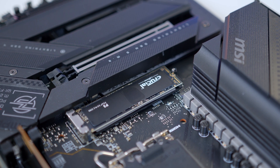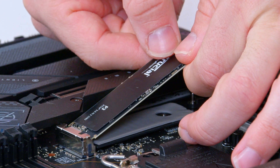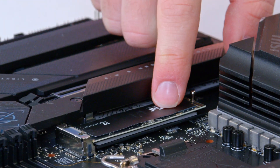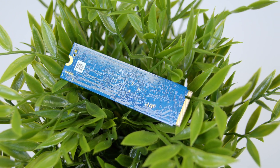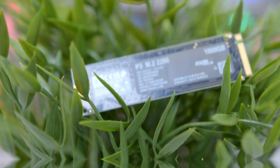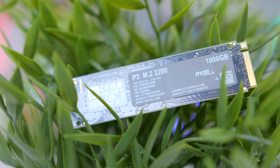The newest standard of drives are what we call M.2 SSDs — a drive like this that fits into a smaller M.2 form factor. It requires no cables and is easy to install, as I'll show you how in just a moment. Originally when M.2 drives launched, some brands would take their older SATA drives and package them in an M.2 form factor, limiting the speeds to their old SATA standards. Whereas this is a fully fledged Gen 3 NVMe. Since then you can also now find Gen 4 drives which push things even further if you've got a bit more cash to spend.